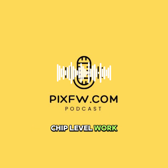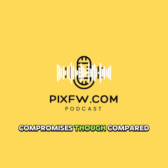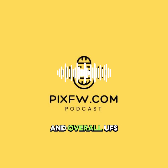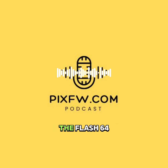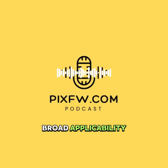It's great for both Android flashing and chip-level work, and often seen as the most complete solution for a typical phone repair shop — easy software, strong community. The main trade-off is probably on the UFS side: its UFS 3.0 and 4.0 support is more limited compared to Flash64, and overall UFS performance, even with the add-on, isn't going to match the raw speed of Flash64. But its speed is generally more than sufficient for most repair scenarios.